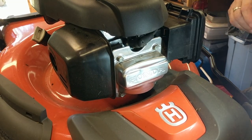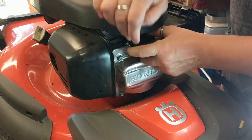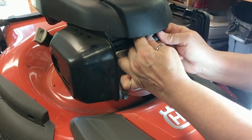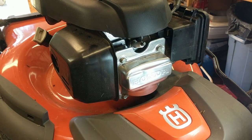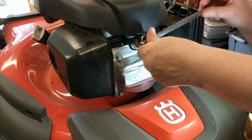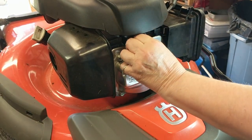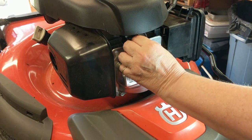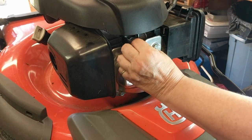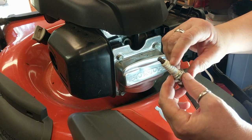First thing is to take off the spark plug cap — sometimes it's kind of tight to get off of there. A little bit of wiggling and there we go. Put the spark plug wrench on there and make sure it's seated all the way. And wow, it was completely loose — that might be one of the reasons she was unable to get this to stay running. Something's really beat up. She'll need a new spark plug. Whatever caused the damage to the front has also cracked the spark plug — it's bent over.